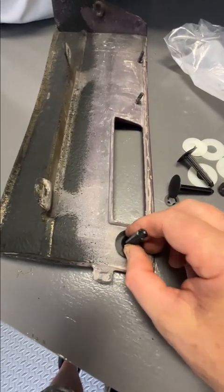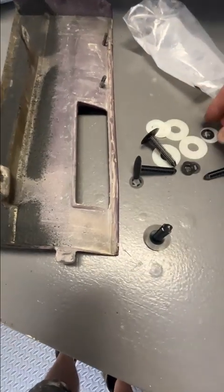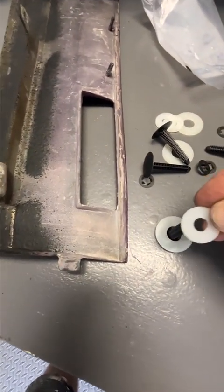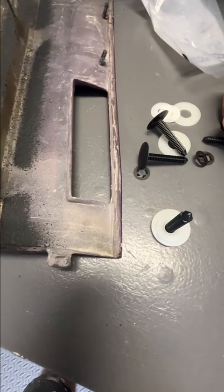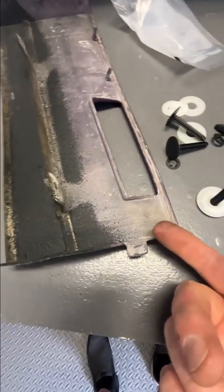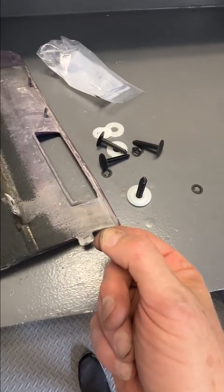...I'm going to set that up in there, and on the back side I'm going to use a fender washer, another nylon washer, and my new retainer clip. I'm going to sandwich it in, and that's going to suck this panel together - kind of like how the OEM ones work, just bigger and better to address this problem.